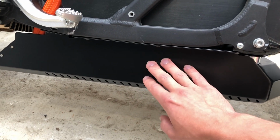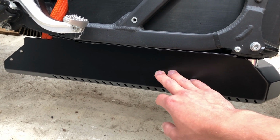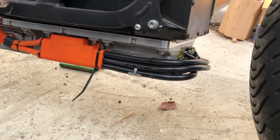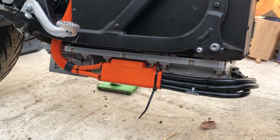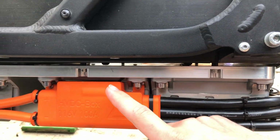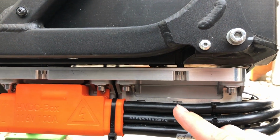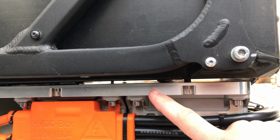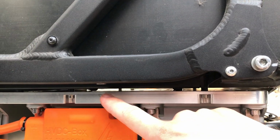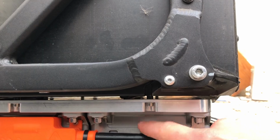Since everything is already mounted and I don't want to take everything apart again, I will show the German footage and dub it in English. So here we can see our chargers itself without the outer casing or the belly pan. And we have our three main DC charging leads from each charger that go back to our splice box. Well, and I just show now the chill plate itself. And we also can see we have an extra air gap between the chargers or the chill plate and the battery. So we have an extra thermal insulation so no heat gets pushed in the batteries while charging.